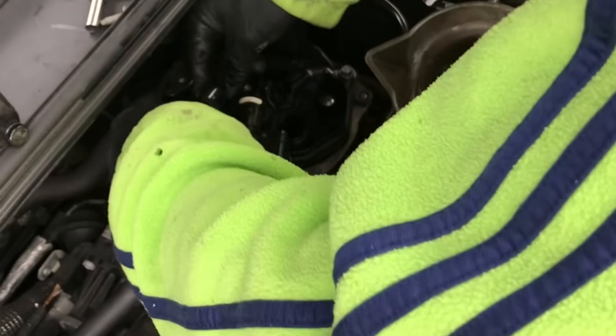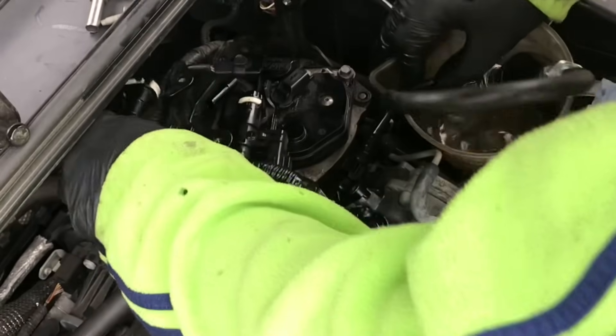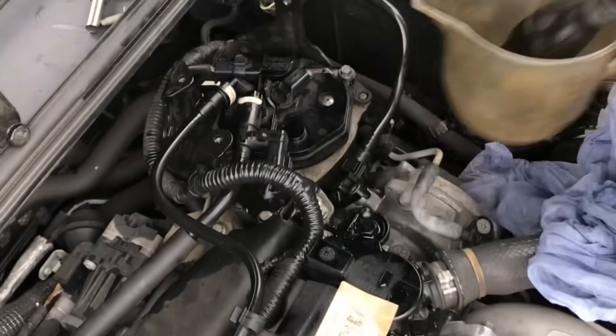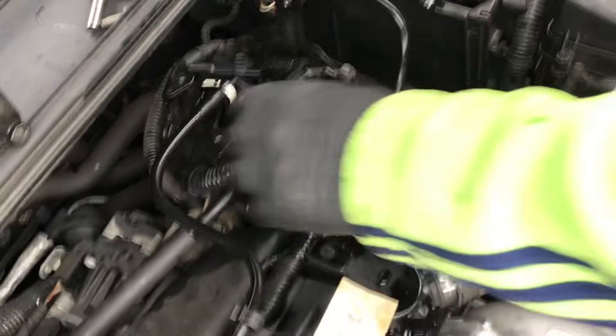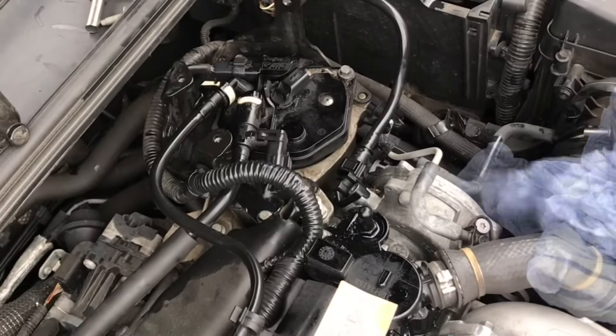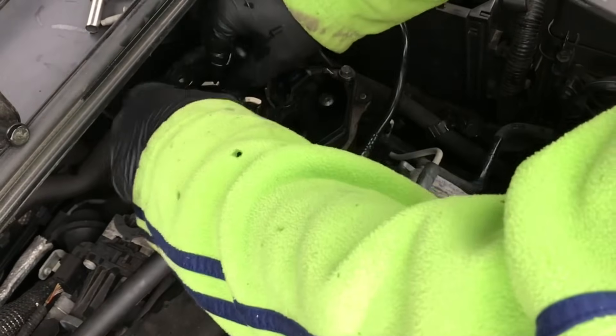Keep pumping the rest of the diesel into the system — that's just forcing diesel into the injection pump through the pipe we've just reconnected, making sure there's definitely no air in there. You can tell when it's clear because you can hear the bubbles and the whoosh of the fluid stop. Get that second hose reconnected as quickly as you can — push it in and make sure it clicks fully in because they can be a bit tight.